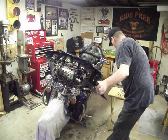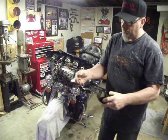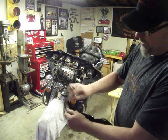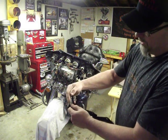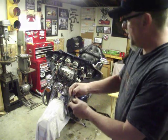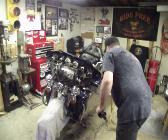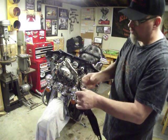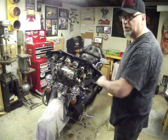I have a support here off of the bike to show you. When you take the bracket and line the radius edge up, it'll settle and it's home there. When it does, you're going to clamp this and drill your holes and bolt it on. You can do this with it on the bike.